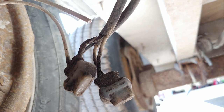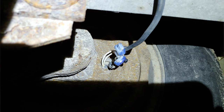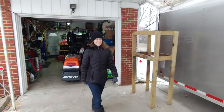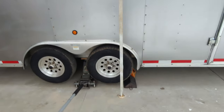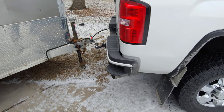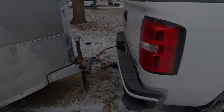But I noticed that both of these axles right here — these two hubs — the wires were broken. I already got it lifted up and fixed the connections. I went to the local trailer supply and got the right stuff. So we're going to go ahead and do some needed tests. I've got my lovely wife assistant with me today to help. I have it set to three and a half on the gain, and I'm going to have her press the gain switch all the way over.